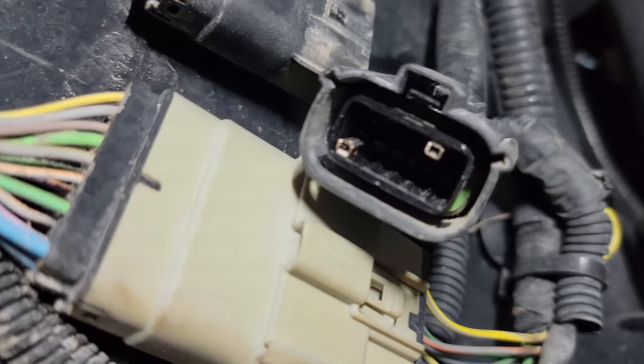This is the last thing we need to do for installation. Go ahead and key cycle - turn it off, turn it back on, then hit OK. This is the moment of truth everybody - lights installed, FORScan programming done. Check it out - we got lights everybody! You turn them off and they dim down - freaking awesome, I love it. Also, the cab lights will work when the doors are closed. If you do not have a vehicle equipped with factory bed lights and you want to install them, make sure to check out limitlessautoworksllc.com. Tell me what you think about this installation in the comment section below - remember to like, comment, subscribe, share, and I'll see you guys next time!